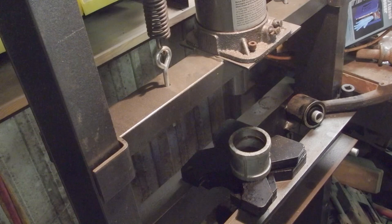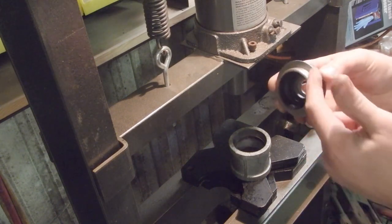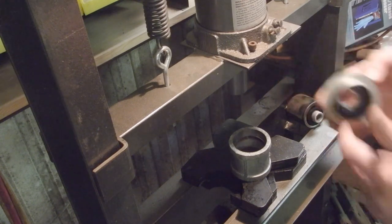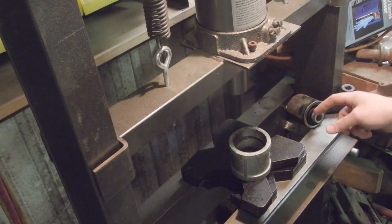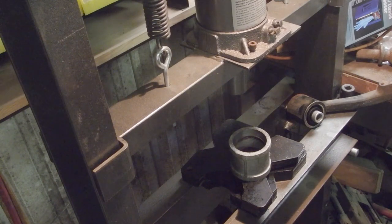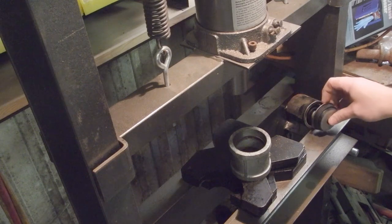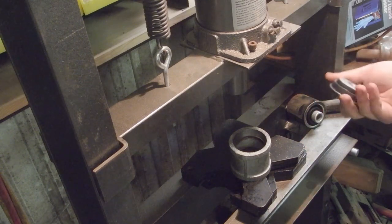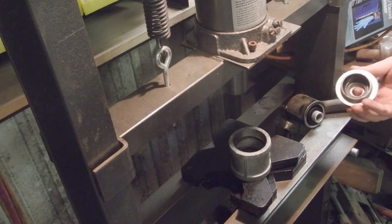These caps — the way they're made, this end is going to press into the control arm, and then this inner piece here is going to press into the tube in the center of the bushing. If you push on either one of these unevenly — either the cap or this — you could end up breaking the bushing, ripping the cap out or whatever.